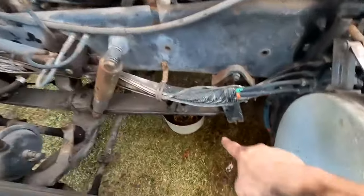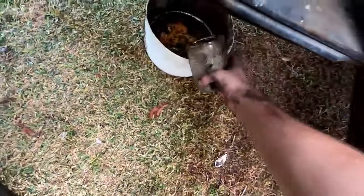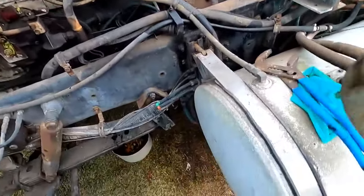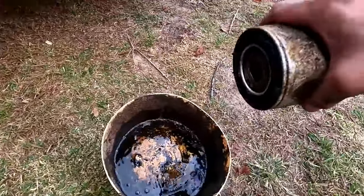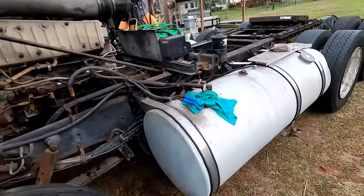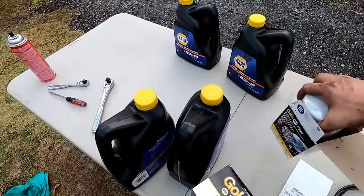I got a drain bucket stuck under there so we're not leaking fuel all over. Look how nasty that fuel is — that's probably why it runs like crap. The fuel is starting to separate. Next adventure is draining these tanks, getting the dent out of that one, and putting some fresh diesel in it. That stuff smells almost like gas — really bad. Diesel's not supposed to be that color. That's 20-year-old diesel for you, but she still starts and runs on it. The fuel filter is part number 3109, so we got the right one — we'll go ahead and change it.